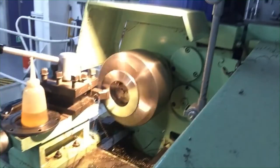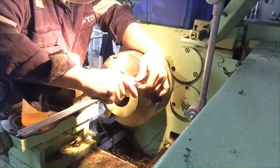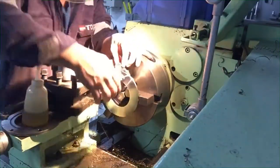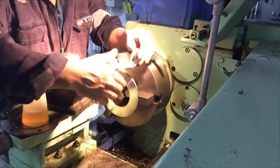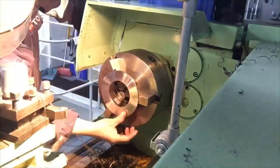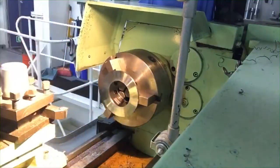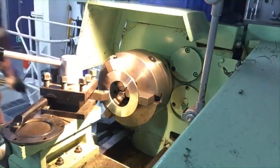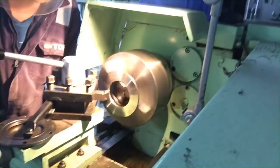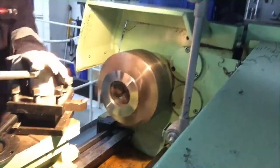That is why some compressors explode, because the triangle of fire is present inside. That is why I told you that you must be very careful with the thickness of this metal crankcase, because as I repeat, once you make it bigger, there is no clearance. Once there is no clearance, all the parts inside the crankcase will be touching each other and create friction, and once the friction begins, it starts a fire, then explodes.